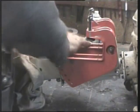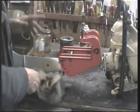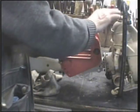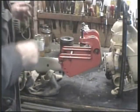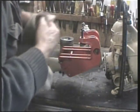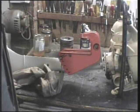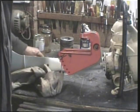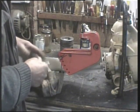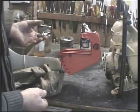All isn't good news. Pan back. Other one. I pulled the engine over without the plug in, and we don't have a spark. Oh, I didn't particularly want to go down that route, but it looks like this video is going to be a mega long one. I thought, well, I will just check that it's not a faulty plug, because you never know, never assume.